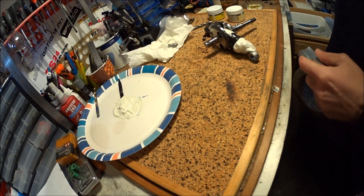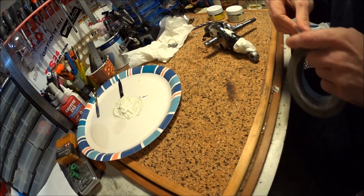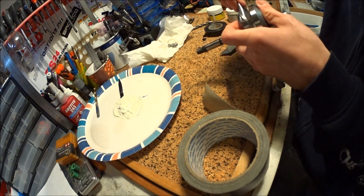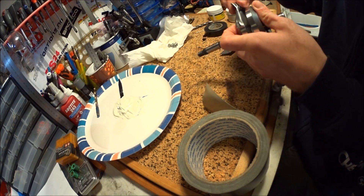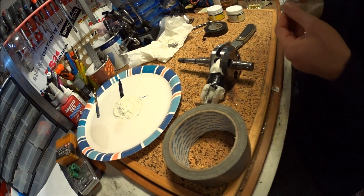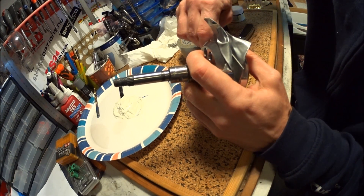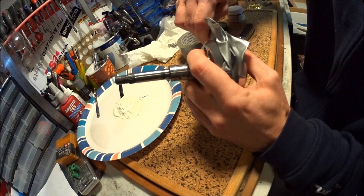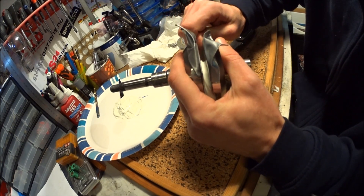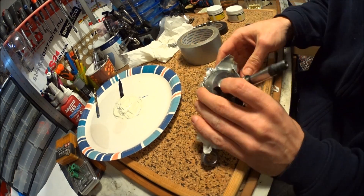I'll apply some duct tape to the inside of the crank webs so that the epoxy and slugs will stay in place. Just use a ruler to push it in place so it doesn't leak out on the back side. Then we are ready to apply some epoxy in the holes and on the slugs. I've got heaps of Allen wrenches because they always come when you buy furniture — especially from Ikea. Ikea sets always come with some Allen wrenches, so I can sacrifice one for the epoxy.